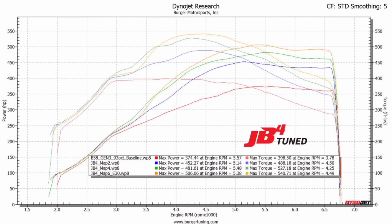The JB4 does make really good power — on their product page you can see it makes over 500 wheel horsepower on an ethanol mix, which is really good especially just for a piggyback that usually runs into fuel system limits. This one clearly is able to push plenty of power without very many mods. It'll work and it'll be an option for those of you willing to push your car to that level. But it doesn't seem like you'll be able to slap big turbo kits on it and really make the high horsepower builds that some people are probably thinking.